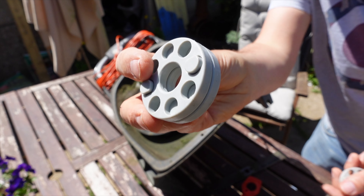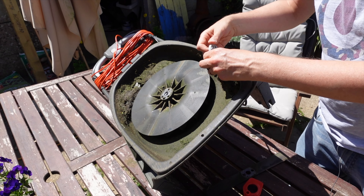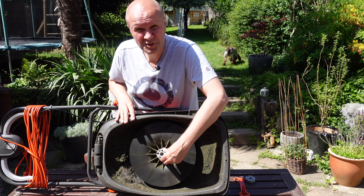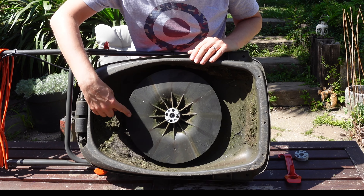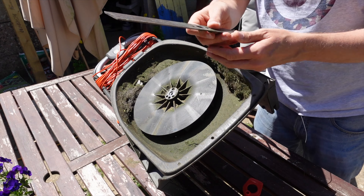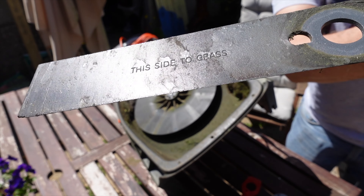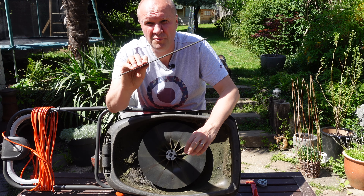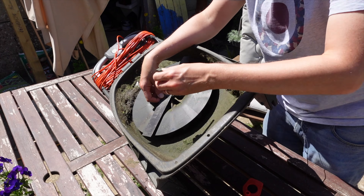What's great with the spacer is that it's got two studs, and those studs fit into the two large holes on the blade mount. There's a lot of debris in the holes on mine, but if you just push it in to where the holes are, it fits snug and is flush with the spinning motor. Then there's a right way and a wrong way to put the blade back on. Thankfully, Flymo have etched 'this side to grass' on the blade, so I'm keeping that side up. The holes on the blade fit exactly onto the studs on the spacer, which stops the blade moving around independently.